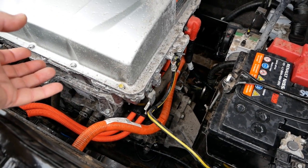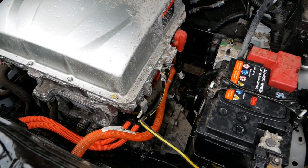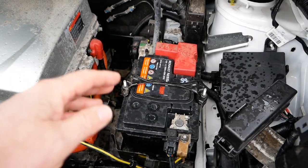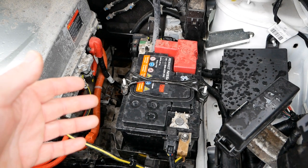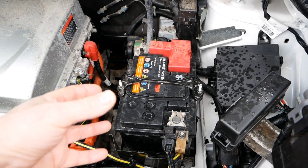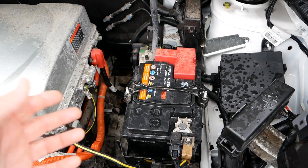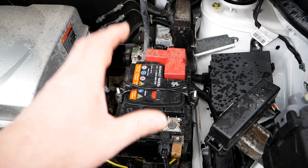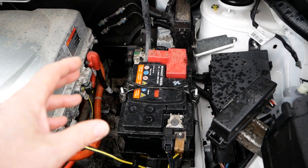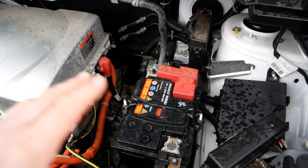The other components are all the electronics — the charger and the inverter systems. Here's a standard 12-volt battery. All EVs have 12-volt batteries just like petrol and diesel cars, and the car is completely reliant on the 12-volt battery just like an ICE vehicle. If that goes flat, the vehicle doesn't start, because it's powering all the ECUs, the headlights, the wipers, the dash, the stereo — everything.